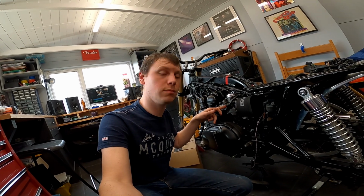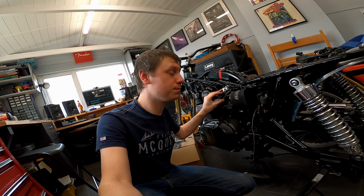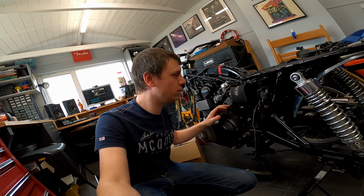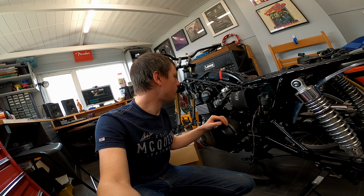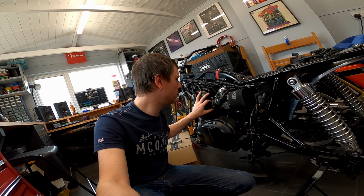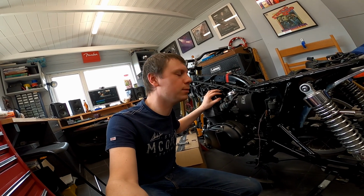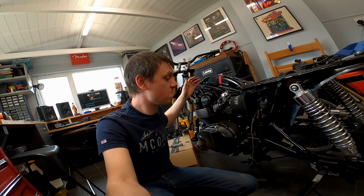But it's a really simple install, getting throttle bodies back in. We've got 2 electrical connectors, one for the throttle position sensor, one for the injectors themselves, and then 4 bolts for the intake tracks, and then we've got 4 clips as you've just seen, and 2 clips for the filters. I still need to fit the map sensor hoses, but they were perished, so that's another common issue on the Bonneville. So need to source a set of them, maybe some aftermarket vacuum hose to connect up to there, but we can do that. And on to the next job.